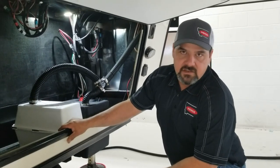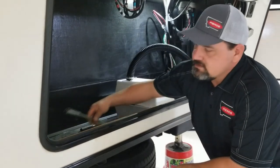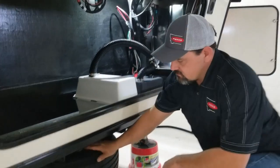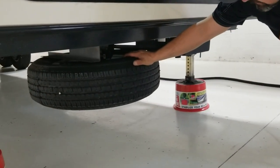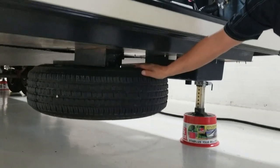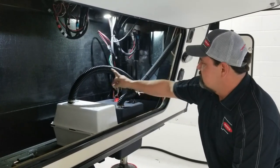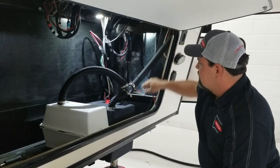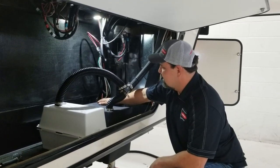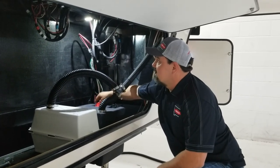We're located in the front compartment of your fifth wheel. You have two stab jack handles up here. One is slotted, one is 3/4. The slotted one you'll use to lower your spare tire, which attaches right here, to lower it on a cable system. You have two Group 27 12 volt batteries. Both are vented out. Your battery disconnect switch is located to the rear behind the right hand battery back here, mounted to the bottom plate.